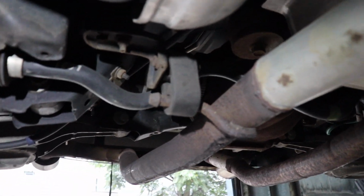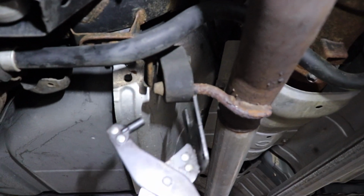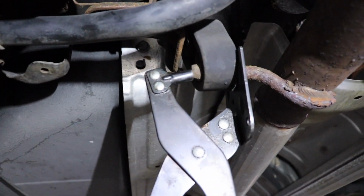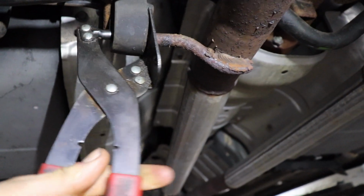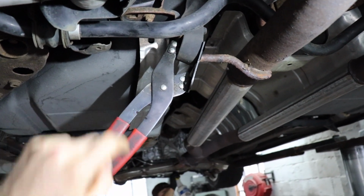You just get the hanger tool. So here's the exhaust hanger tool. I know I've showed it to you before. This is the tits. Pretty much all you do with this is you put the back side of it around the hanger that way, and then you just squeeze it like a pair of pliers, and it comes right out. Now I'm not gonna get too crazy with it because otherwise the whole thing's gonna drop. Check them out on Amazon. I'll put a link down in the description for you guys.